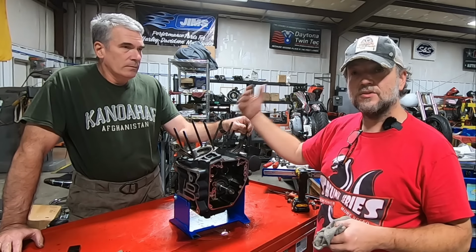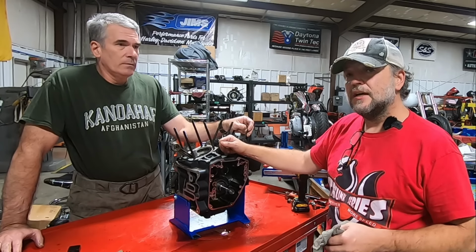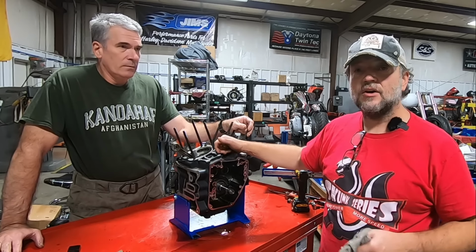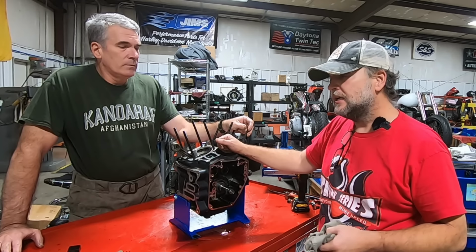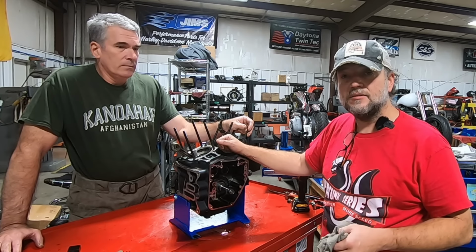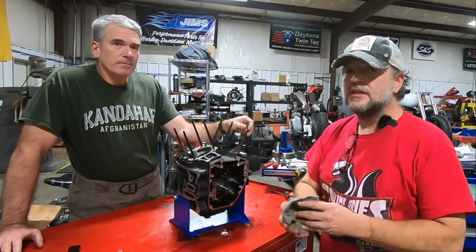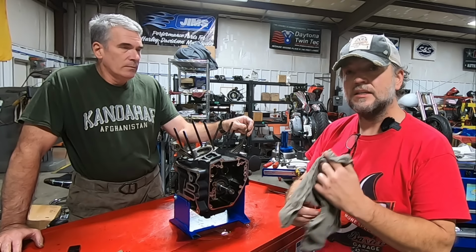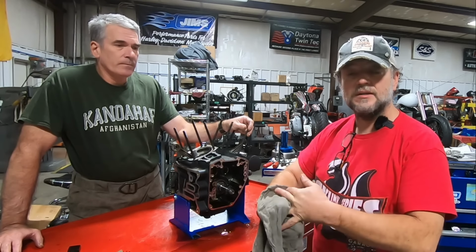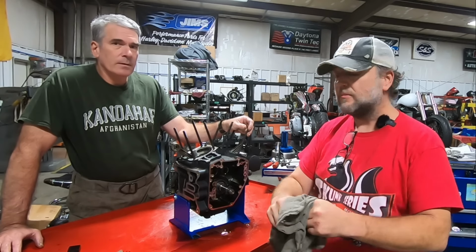And then that took the rings out. Once it did that, it starts building up carbon, and carbon everywhere like crazy. So much carbon, it began to detonate like you would expect to see. And then started running the octane booster. So if you're looking at those clues, starting from the front and working your way down, that's the reason we do these teardown videos, is to give you guys some tips and tricks on how you might be able to diagnose some stuff for yourself. So, Mike, thanks for your help.